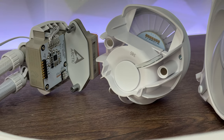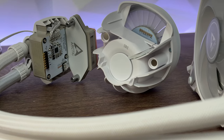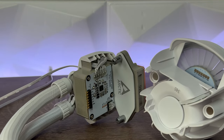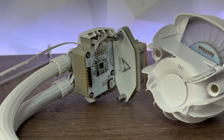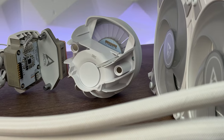Now for the CPU block: the VRM fan runs from 400 to 2,500 RPM, controlled via PWM. The pump runs from 800 to 2,800 RPM, also PWM controlled. The cold plate is copper with micro skive fins, and the overall block dimensions are 108 × 76 × 80 mm with 12 addressable RGB LEDs inside.